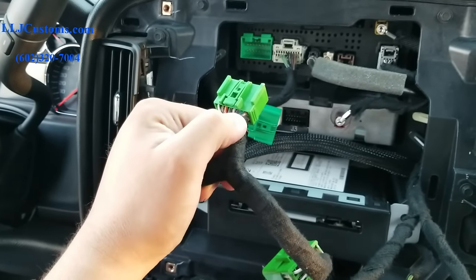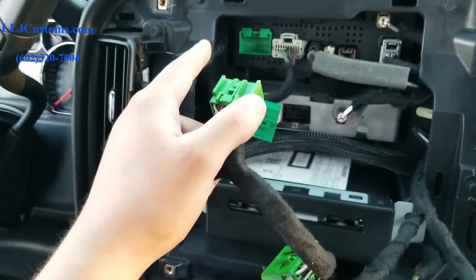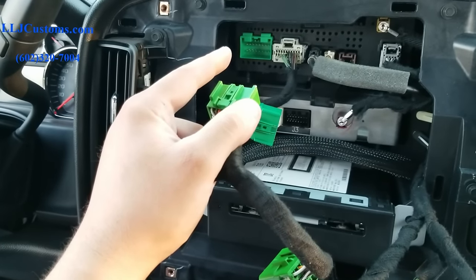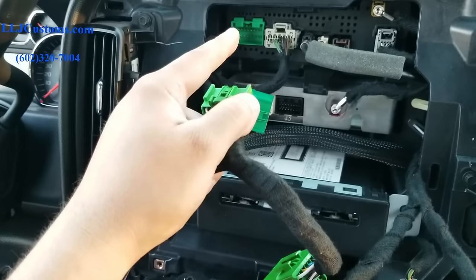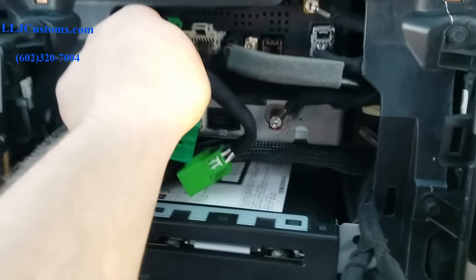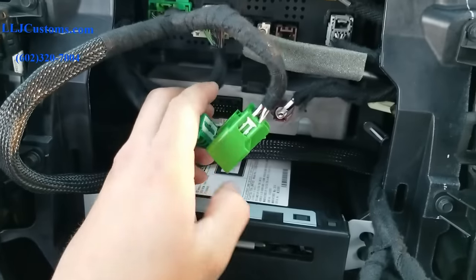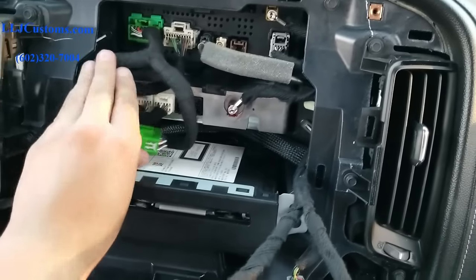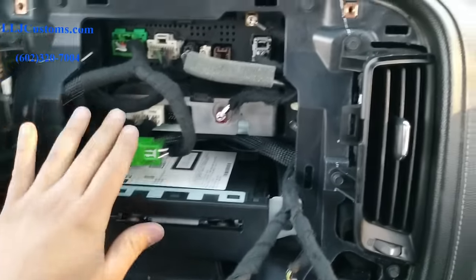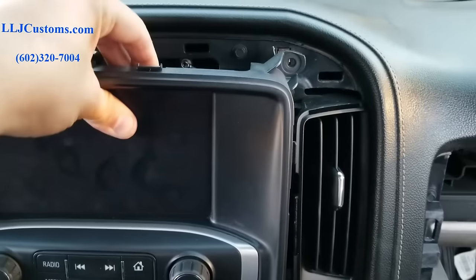Some 4-inch screens have the green plug as well, so it's always good to verify. The 7-inch screen has a tan plug and a gray plug, so it's really important to know that. The work models just have a tan plug and the radio unit itself is a metallic silver. So you grab this, wait for it to click, and then grab this here and click that in as well. Then just hide the harness back here — tuck it in and you're done. It doesn't have to be hidden because you have all this room behind the screen.